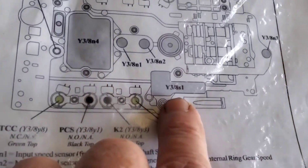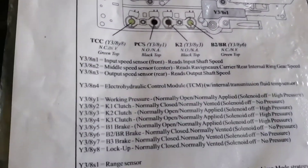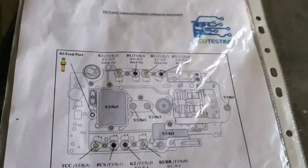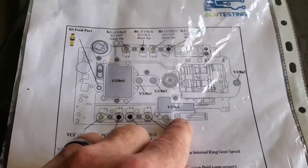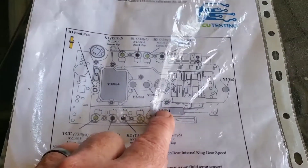I'm going to look into possibly getting a new Y3-8Y1, and then Y3-8S1 is my range sensor. I'm not sure if I can just pull that off with a couple of bolts and replace it, but I read somewhere that there's a little magnet inside that might get coated with fine metal debris. Since the first time I did the transmission service there was an appreciable amount of very fine metal debris on the grid-type magnets on the bottom of the pan, so it's conceivable there could be a fine layer of metal debris on an internal magnet. So I'm talking myself into, for the third time, lifting this car up and taking that pan off.